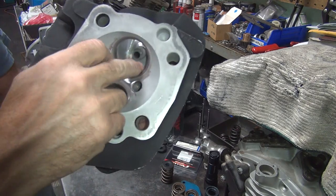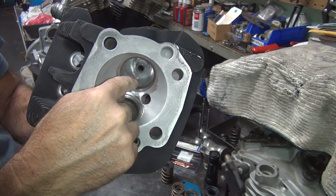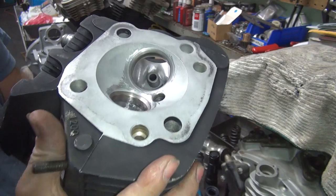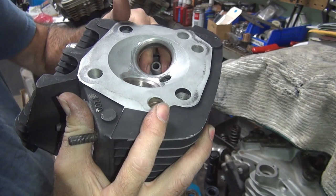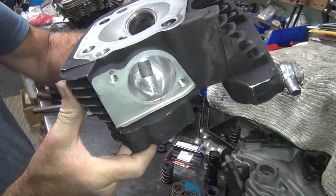We opened up inside the valve guide bowl area. This bowl got opened up, the seat diameter got cut, and the bowl got cut. So now you've got airflow that goes all the way through - you can get your fingers up both sides of the guide now. So that's what we now have for our port.